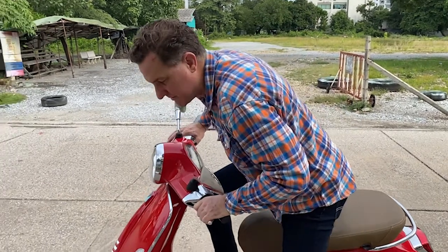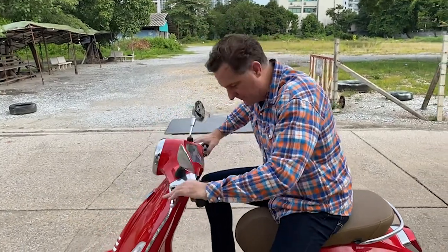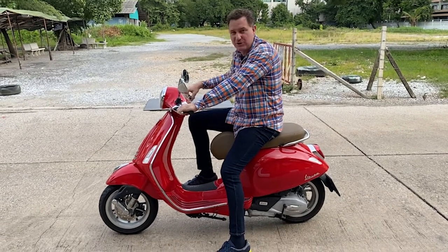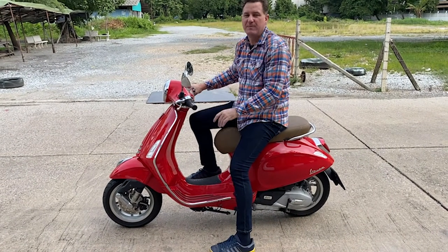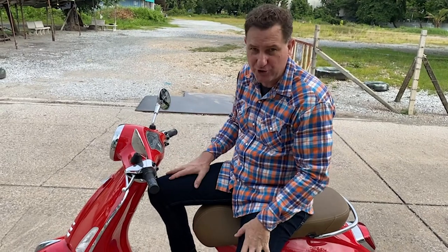So what happens when you've got your rear brake on, your bike's not moving anywhere. So you've got this bike fully under control. If you're sitting at a set of red lights, you'll be in a position like this. Your left foot's down and your rear brake is on. When the light goes to green, what we're going to do is use a little bit of throttle and then ease the brake off. Now the reason we have our brake on is to get you familiar with using the bike mechanisms to control the bike, not your legs.